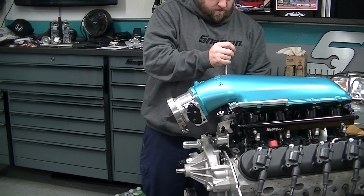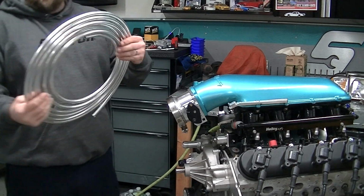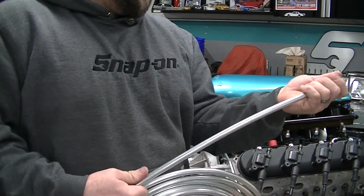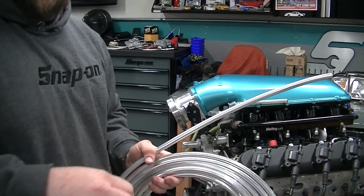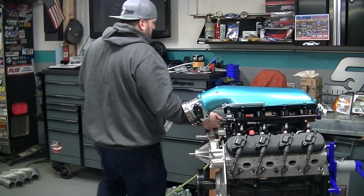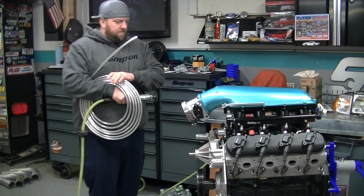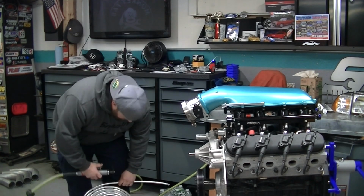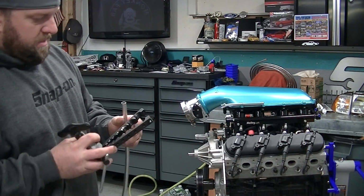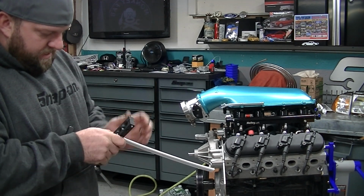return hard lines. Got some half inch aluminum fuel line tubing. It's cheap. It's like 20 bucks for 25 feet of this. Not expensive at all. The fittings add up, but it's still not terribly expensive. Oh, the same Rigid flare tool that we used to do brake lines goes all the way up to 3/4. So, get to use it again.